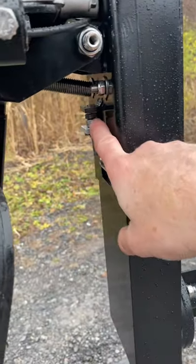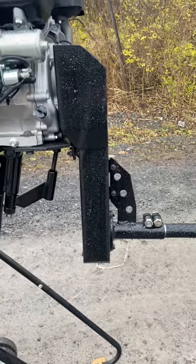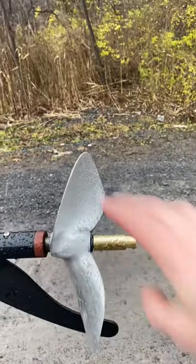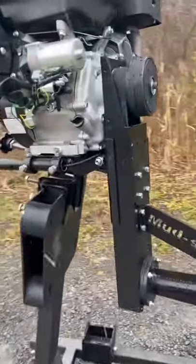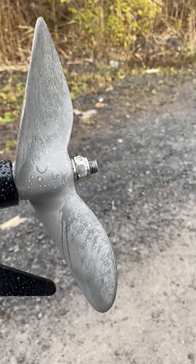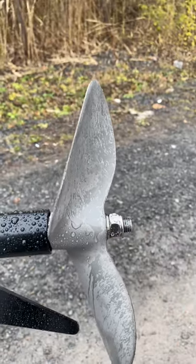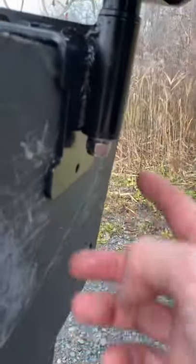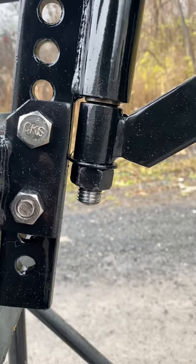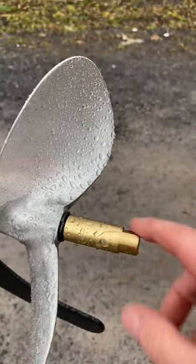This little bolt back here is just a belt tensioner. The SD300 is painted steel, stick welded, and at the bottom has a standard two blade aluminum propeller. The 13 horsepower light is aluminum, MIG welded, and uses a solid stainless steel propeller. There are also a lot more lock nuts on the 13 light — on the propeller and on the lock nut holding the transom mount to the engine base. The SD300 just uses a standard hex nut, and we would advise putting Loctite on it. The brass propeller nut has a lock washer but is not a lock nut.